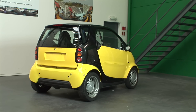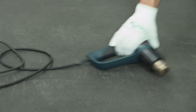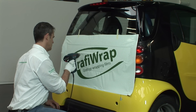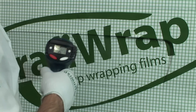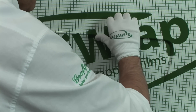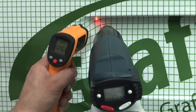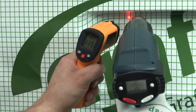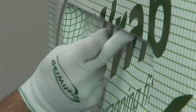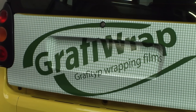Some cars have very deep indents. Here, it's very important to apply the film to these indents in the right way. The film should never be stretched in the curve of the indent. That's why we always heat the other side while we push the unheated film into the indent — in this way, the film is only stretched over the even part of the indent. After heating at a temperature of 350 degrees Celsius on your heat gun, leave the film to cool down for a moment, then press it firmly once again. This will ensure a correct result.